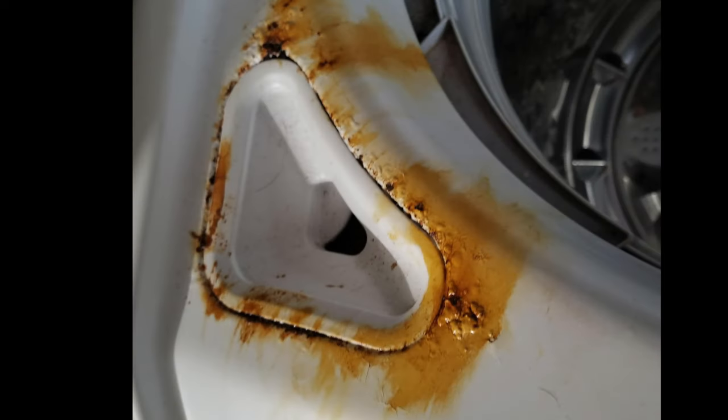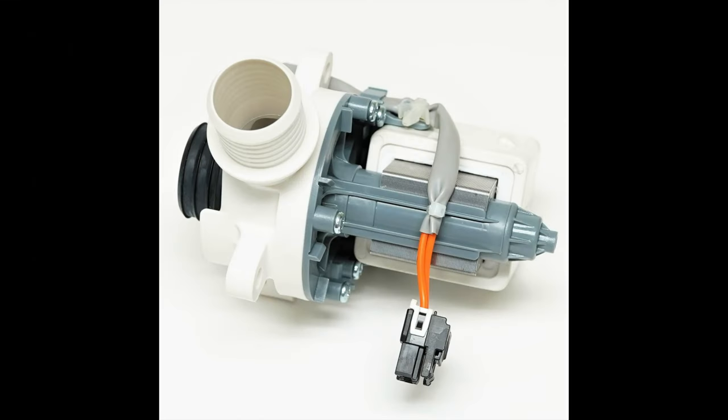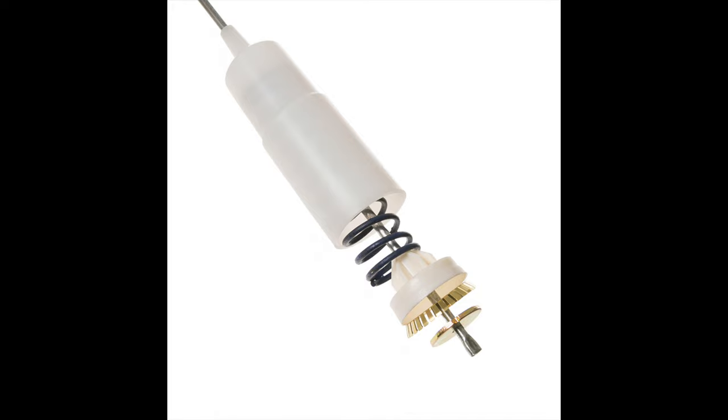It has a deep rinse option that removes all traces of dirt and detergent for fresher laundry. The only drawback is that it doesn't have a detergent dispenser. I actually think this is a good thing, because adding your detergent and bleach directly to the water in the tub prevents localized corrosion. It's common on brands with those convenient little trays that become centers of rust and corrosion after a few years. The most common problems I fix on these machines tend to be the water inlet valves and the drain pumps. Surprisingly, the suspension rods are not a common problem with GE machines — they're engineered differently than Whirlpool rods and usually last the life of the machine.